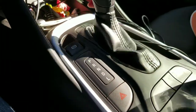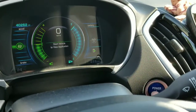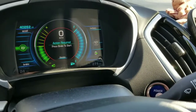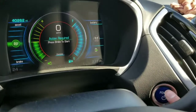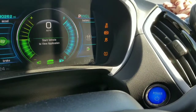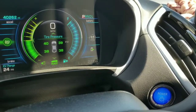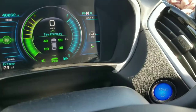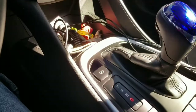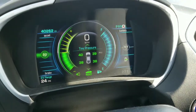So I basically have to shift back to park and push the button to power back on, and of course put the brake pedal down. It starts back up and then initializes, so this whole process takes less than a minute. But it has to be initialized with the gear lever in park and the brake pressed, just like a normal startup of a regular car.